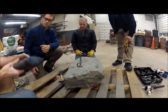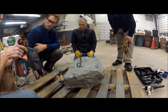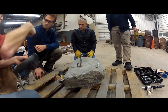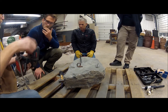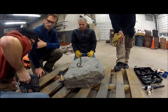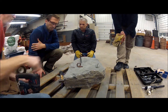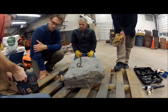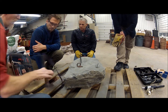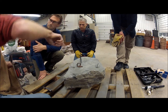So there's two modes on this: regular drill mode and hammer mode. What we're going to do is put the drill on and use hammer mode, because it actually has a piston in there that knocks the bolt. And as soon as it starts to turn, we're going to switch over to drill mode. You don't want to just lean on the drill because when it starts hammering it will go in and then this wheel can spin. You're just holding it steady, not pushing it in — just letting the hammer do its work, tapping on it da-da-da-da-da. That will loosen the collar enough to let it start to turn.